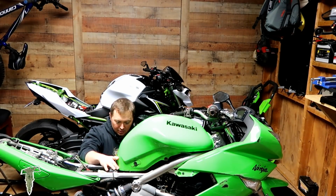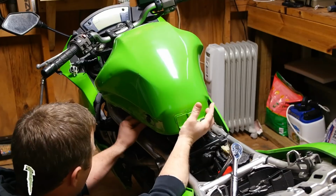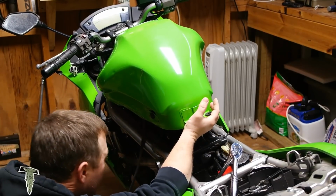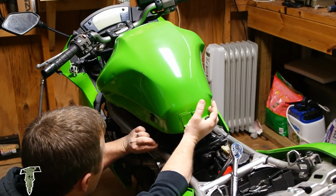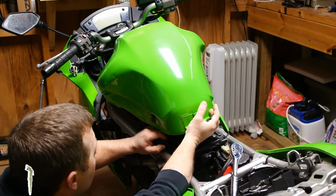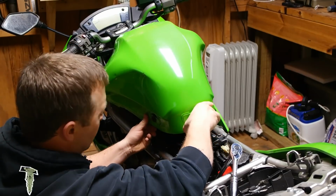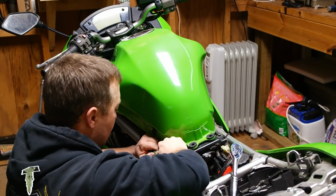Okay. So we've got these 2 bolts out. There's 2 harness connectors. There's the vent line here. Go ahead and pull this up through. And there's the fuel line, connects on the opposite side. Oh, I'm probably going to have to get something to wiggle these apart. They don't look like they've ever been taken apart. Old electrical connectors. Hey, that one wasn't too bad. And this one. This is usually the one that'll give you a hard time. Or not.